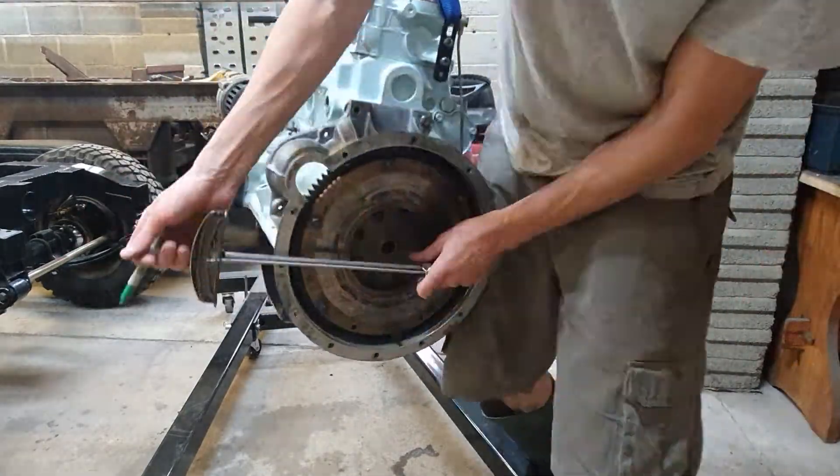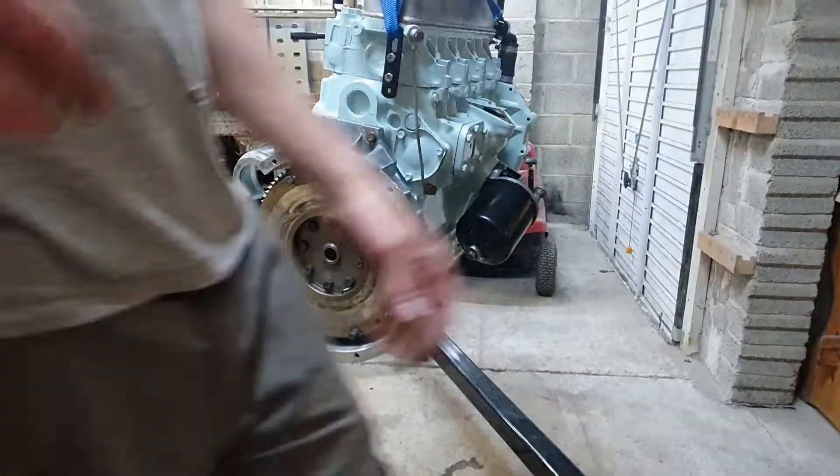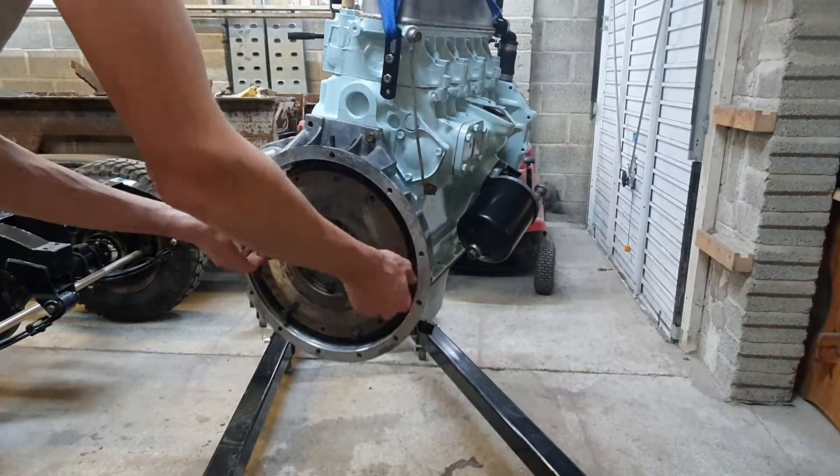The highest bolt point is still accessible from the outside of the engine, so it's all right. Those are all torqued up, the flywheel is now on and torqued up, and then I'm putting some grease in the spigot ready for the gearbox to receive it.